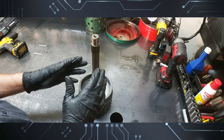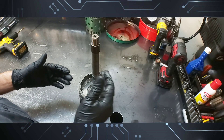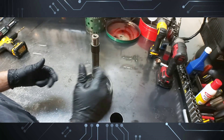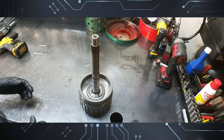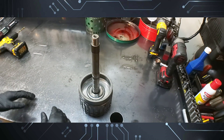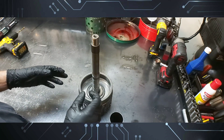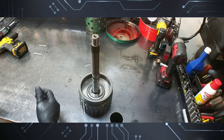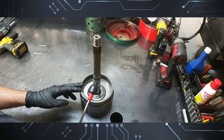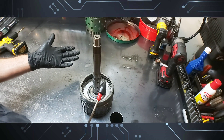It also did some weird stuff going into fifth, and then all of a sudden it would skip fifth gear every time. We did not get it to trigger the shift solenoid E code any longer, but I got an incorrect gear ratio code in fifth gear. I said okay, we're getting somewhere. Let's drop the pan and inspect it, because we managed to make it do something and I actually felt it slip a few times. Long story short, we dropped the pan — the fluid was perfect, still cherry red. We had to drive it at least two hours to make it do something.